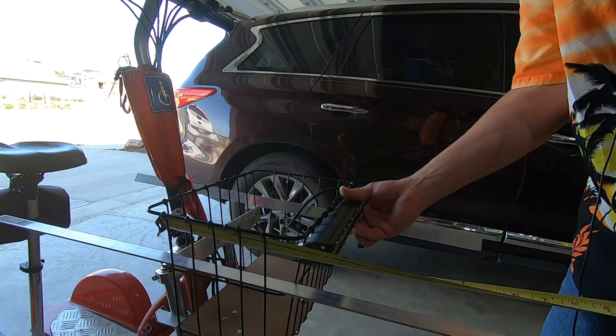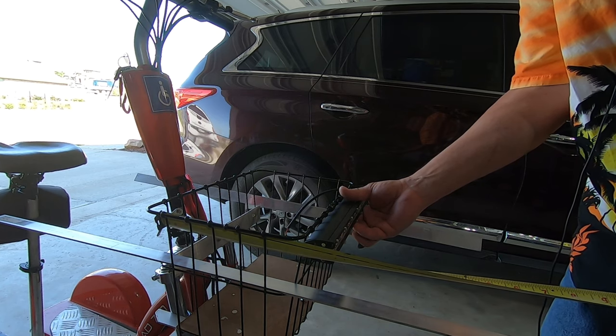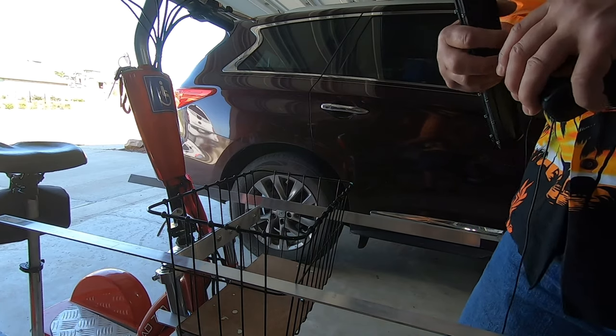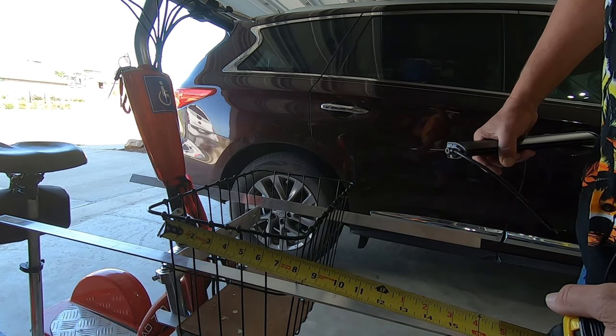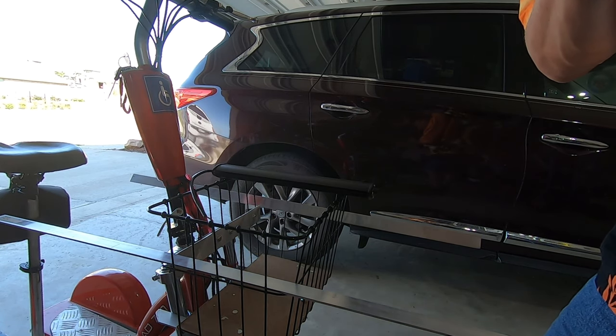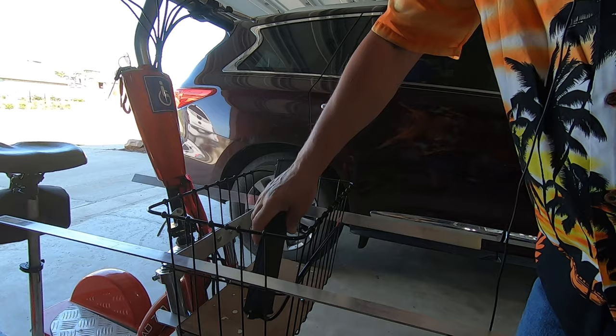it looks like a 10 inch piece of aluminum bar stock will work good. So I need two 10 inch pieces, and then the sandwich piece, probably 7 inches. We'll go with 7 inches. So we're gonna do two tens, and instead of seven, I'm gonna go to eight. That way I've got a little room to play with. All right, so let's go cut some metal.